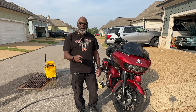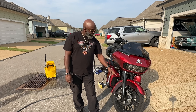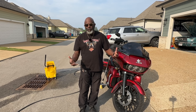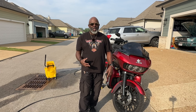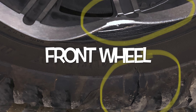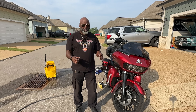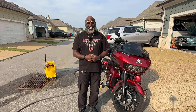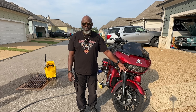The number two reason why you might not want to upgrade to a 21-inch wheel is safety. The 21-inch wheel has a smaller sidewall. The 17 or 18-inch front wheel has a bigger sidewall and can absorb bigger potholes and obstacles you might run over in the road. It happened to me with the stock rims — I'll show a picture of that here. I was riding at night and whatever I hit went through the sidewall of the tire and bent the rim, and that happened on both front and rear. Fortunately I didn't go down, but I did blow out both tires. So safety is a good reason not to upgrade to lower profile tires that come with a 21-inch wheel.